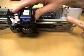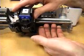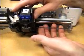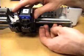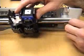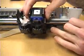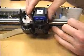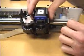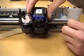Instead of a plastic disc for a rotary encoder, here a linear encoder is used to measure the linear motion. Again, it's a long piece of plastic with a similar gridwork of black lines printed onto it, and as the print head moves over the stationary plastic component, photosensors detect and count those slots as they go by, allowing the printer to measure and control this linear motion.